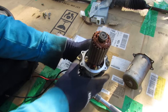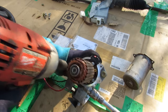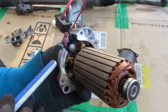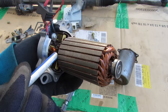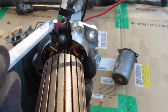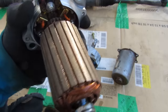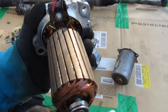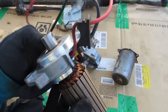Removing the two 14mm bolts that hold this armature assembly to the spiral gear assembly, I can pop this off — this is the armature assembly. Taking a close look inside, we've got our individual coils wrapped around the armature. This is a brushed motor, and the power supply is going to provide power over to these four brushes all the way around. That's what individually powers up each coil set, and then the magnets cause them to rotate. There's also a little bearing on each end.